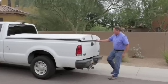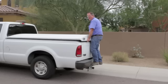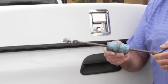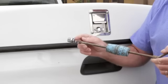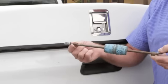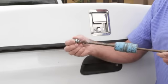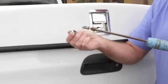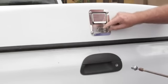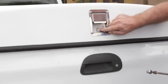Most hard covers can be broken open by simply standing on the bumper and lifting really hard until something yields — that's not going to happen with a Herculoc. Most lock cylinders can be easily defeated with a slide hammer. All the thief has to do is screw the slide hammer into the lock cylinder hole, and a couple of swats pulls the lock cylinder out of the lock. The Herculoc has a barrel-type key like a vending machine — it cannot be defeated with a slide hammer.